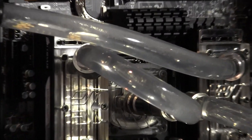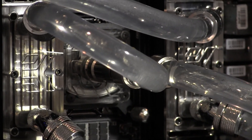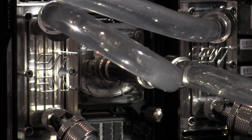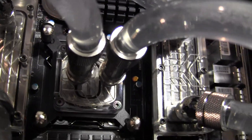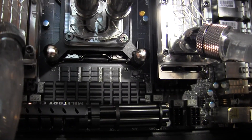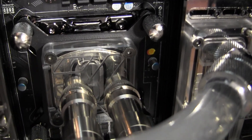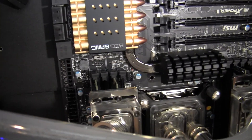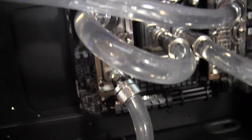You can't really see any major bubbles — there are some tiny ones, but that's just going to take time; I'll let it run overnight. The water blocks look really good. Both of the RAM blocks are nice and cool. Let's get a close look at the CPU block — it's doing good. You can see a couple of minor bubbles right at the top but it's looking so good. You'll see some little white bubbles in the tubes — I only have the pump set on three and I've been adjusting them a bit.